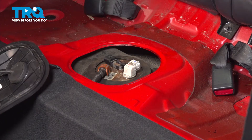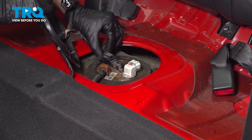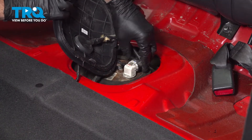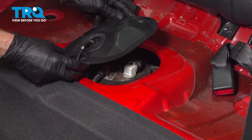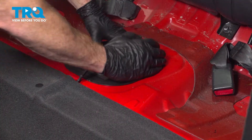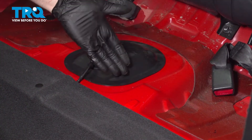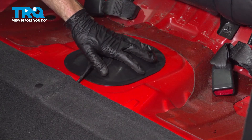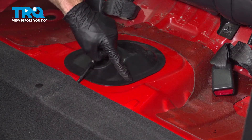Continue on with your electrical wiring harnesses — take this one, press it in, listen for a click. Give it a little tug to make sure it's secured, then do the same process for the other one. Reinstall your protective cover, get it in the proper positioning, and press it down as hard as possible. Make sure it's stuck down — if it does not stick down, you could potentially get moisture or debris up inside your passenger compartment. If you have to reseal it, lift it back up and make a nice bead all the way around.